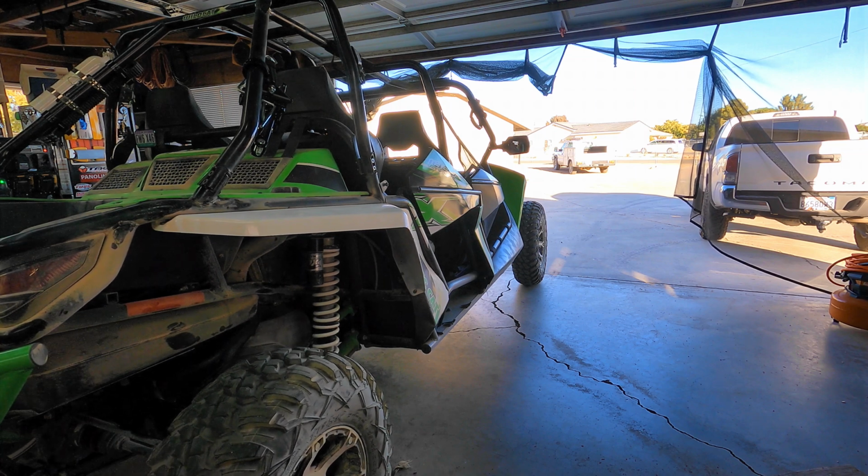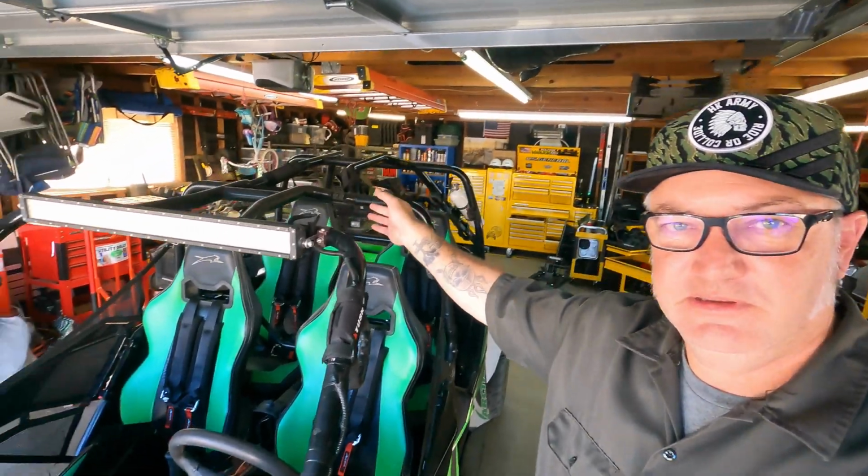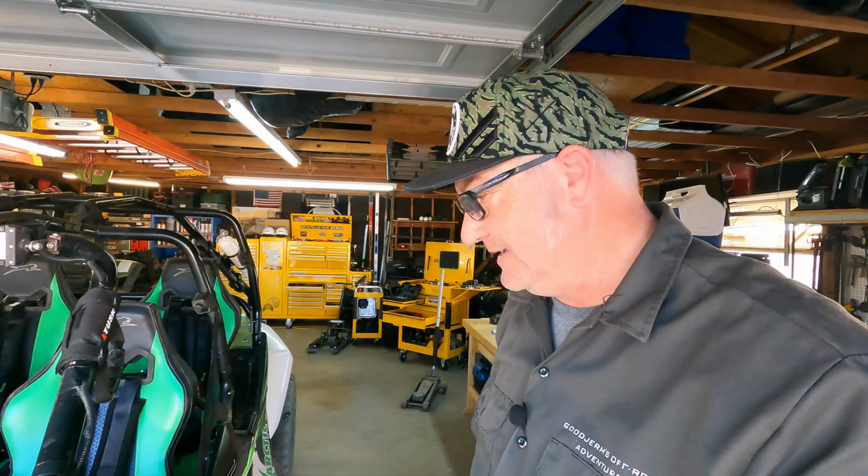Like I said, I will never get tired of the way that engine sounds. Well, I guess that's going to do it. We changed the belt on the Arctic Cat successfully, and it's nice now because it doesn't seem to want to lurch as you're just trying to move it. So now we've got a few other things to do. You probably noticed the speaker thing is now gone because I just couldn't fit with my helmet. Just kept smacking it. So I've got the wiring still to pull out from that. What else? The sway bar bushings, they're shot for some reason, so we're going to replace those. They're pretty simple. Just a couple of bolts, change them out, no big deal. And that should tighten this thing up for the next ride.